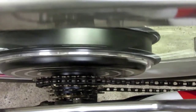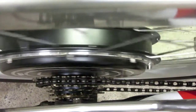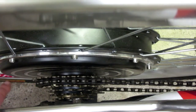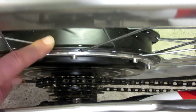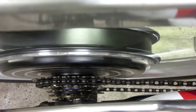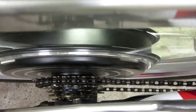So that's the main issue. But if you take a look at the rim, which you can just see at the corner here, this actually spins straight. So I think what happened was the guy saw that this wheel has a defect, which is a wobbly hub, and then took it to a bike shop and had them true the rim. And they did that. Unfortunately, they probably also gave it a zero offset, which made it not fit the bike. So I think that's probably what the history is. So that's the main issue.